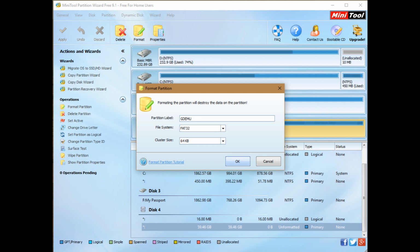The second thing I want to mention is he recommends the software from the SD Association to format it. That's not going to work, at least under Windows 10, at least their most recent version. That software did not allow me to format the card as FAT32, so that's not going to work with this. I had to find a different third-party program. Here's a screenshot of it. I don't necessarily recommend this one either because it took a really long time to format the card, but it did work, and here are the settings that I used.